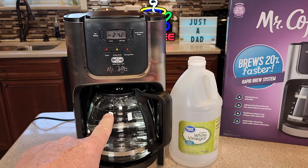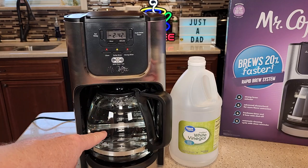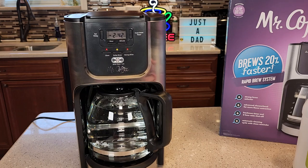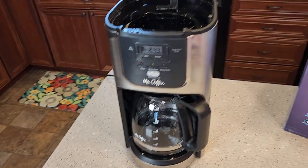I came back after a while and it's done with the cleaning process. Be careful — that will be hot. Dump that water and vinegar out, rinse the carafe out with soap and water, and fill it up with fresh water. We're done with the vinegar now and it's going to be fresh water rinsing. It's also a good idea to rinse out your filter basket, as it's going to have some water and vinegar on it too.